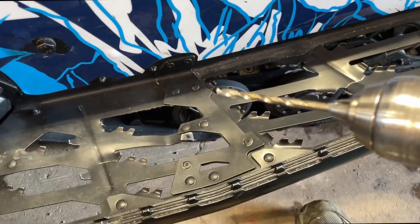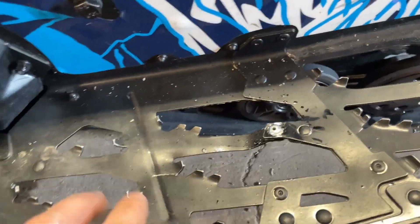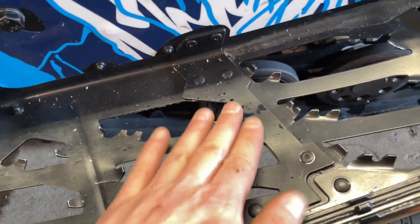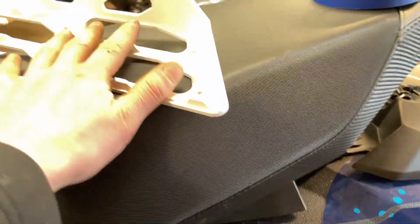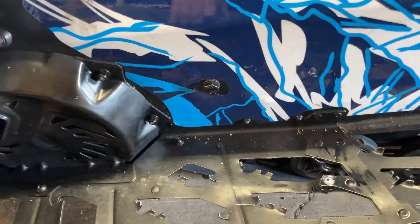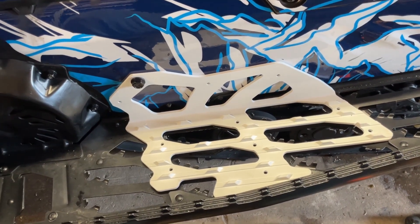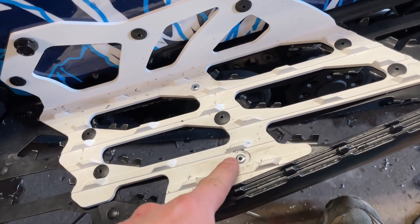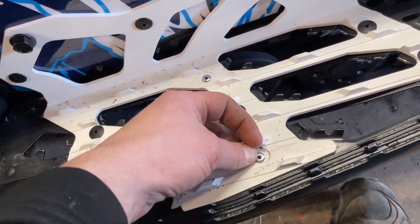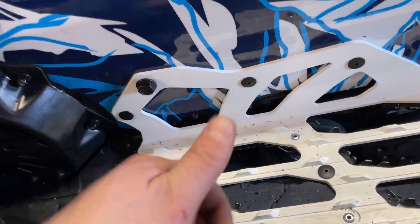Time to move on to the other side. First thing I'm going to try is drilling the old rivet out — I ended up putting a quarter-inch bit in there because the hole was closer to that size. I tried tapping it flat through here as well. There are two rivets on each side of that so I'm not overly concerned. Just repeat: bolt in, tape off all the holes, drill it, clamp up the middle. I had to redo a couple because they didn't make it all the way through, so I used a slightly longer rivet to hold it together, then tightened down the bolt.